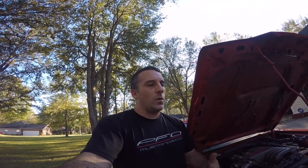So for a while, my car, at cruising speed, like 40 miles an hour or so, in third or fourth gear, would almost surge, and you could almost feel it in the gas pedal. Come to find out, it was a vacuum leak. Fixed the vacuum leak, car ran great. I could not believe it. It didn't do any of the bucking and snatching anymore.